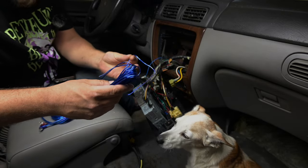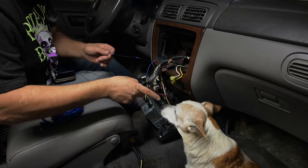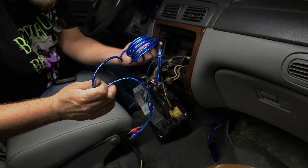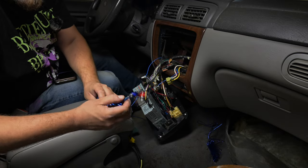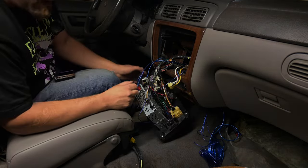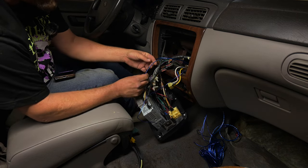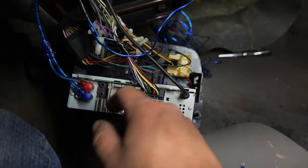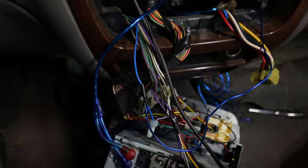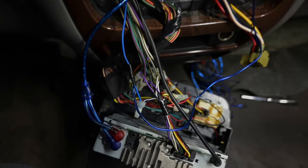So what I'm going to do is take the remote wire, leave it rolled up, and just kind of shoot it down there. Jack is here helping. This is the RCA — this one has a straight end and they have 90s on this end. Now I'm going to figure out some way to hook into this remote because I'm not really sure what this remote wire is going to. So here are our RCAs. I don't really know where that wire goes, so I just spliced into it, soldered it, and then taped it. That should work just fine.